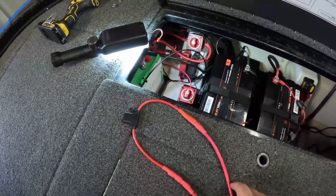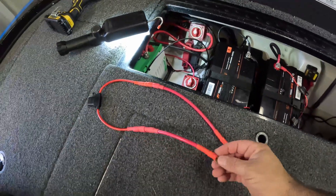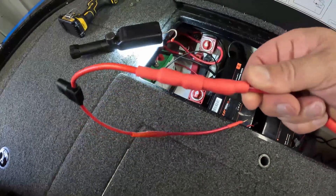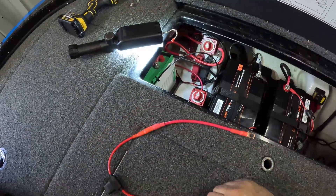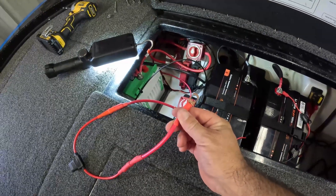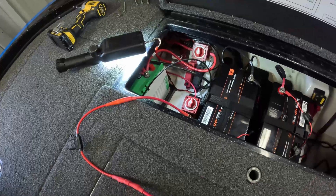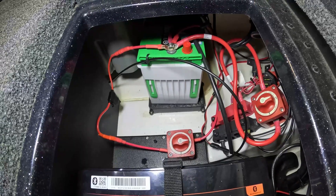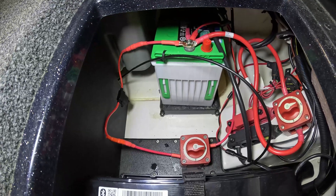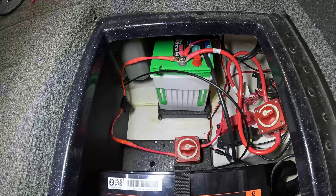I ended up just disconnecting both ends of this wire. I disconnected the other end from the switch there just so it was easier to work with. And I got my inline fuse attached on both sides with some heat shrink. All we have to do now is install this back on the battery and then on the switch. We have successfully installed our new inline fuse — much closer to the battery, so we should be that much safer.